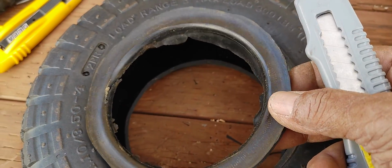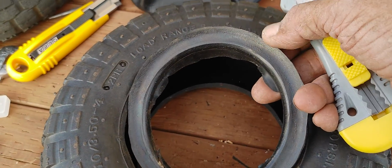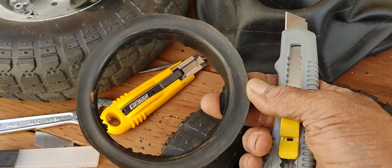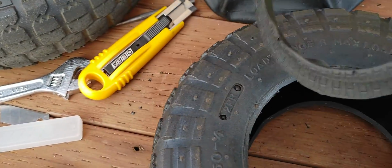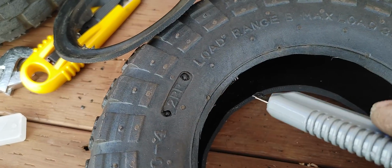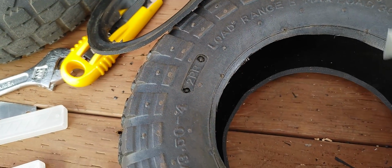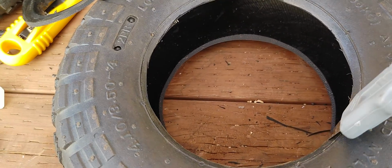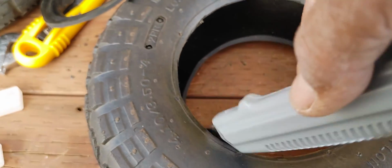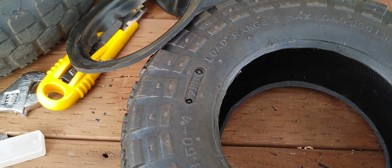And so that's how I cut away this 1/2 inch rim right here. And you can see it doesn't look like I did a circular cut straight, but what matters is that you are inside this line right here, about 1/8 of an inch inside this line. And so what I'm going to do is come back now that I have this open, and I'm just going to clean it. And you can clean it basically by just running the blade gently around the edges right here.